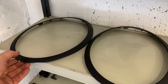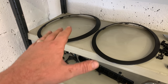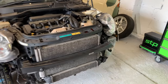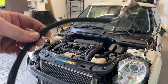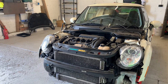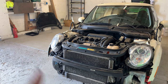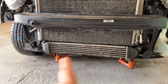I'm not quite sure how the light surrounds are going to turn out because they're on the bonnet against the other body colour white, but hopefully it's going to be all right. I took off the actual sensor underneath — that's all ready to go back on. I had to break it off in the end so I could get a socket on it. It wouldn't budge, so I put a blowtorch on the actual connection to heat it up because it was welded — the sensor bonded itself to the manifold from the heat of the exhaust. I heated it up with a blowtorch and then popped it off. Still waiting for the intercooler from that company, hopefully that turns up.